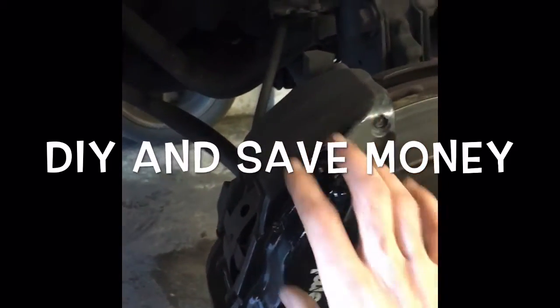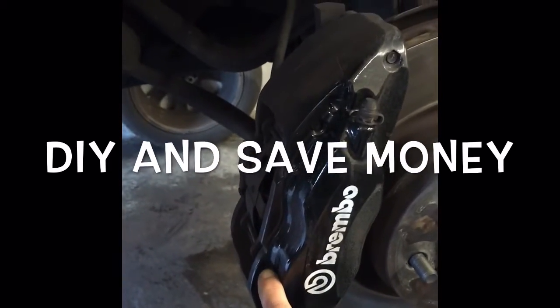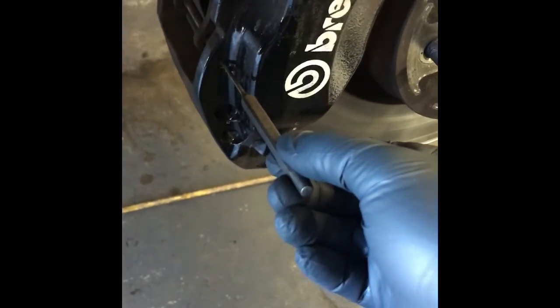The next thing to do is we're going to remove the brake pads first, and we'll start by knocking the pins out here and here. The tool you'll need is a punch like so, and you'll put it where the pin is and you'll hit it with a hammer and drive this pin out. If your free hand — or after you knock the initial pop through — you'll use your fingers and push down on this clip and the pin will pop out.